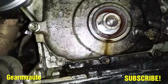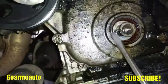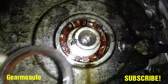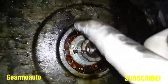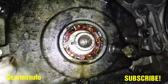I'm gonna clean this area up after I get this old seal out. You can use a flathead or a seal puller. If you're good with a flathead you can get it out — just be very careful not to gouge the inner race of this area. It's easy to gouge, so you gotta be careful getting the seal out.